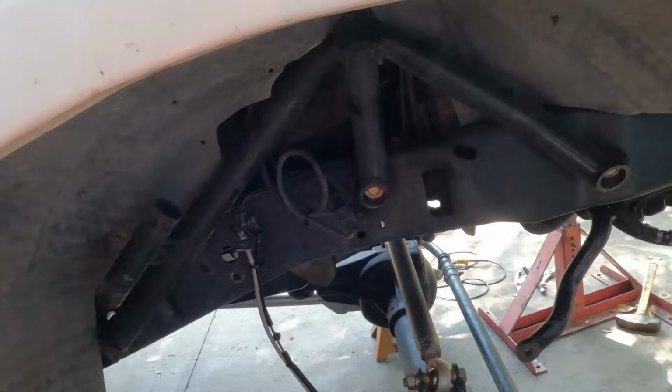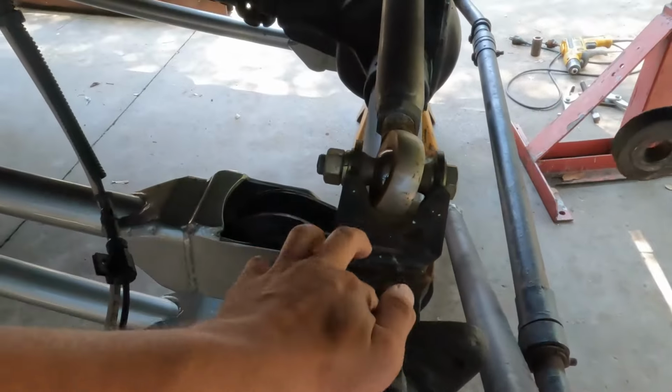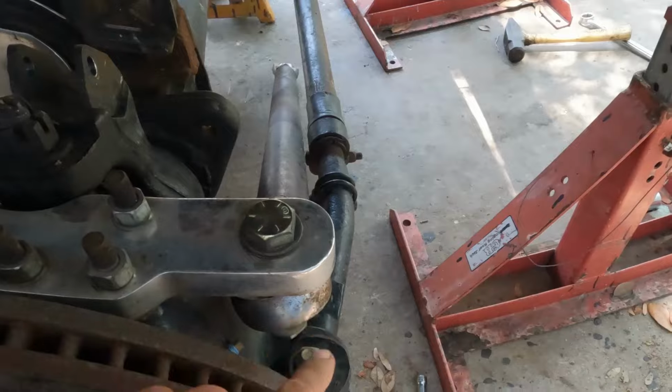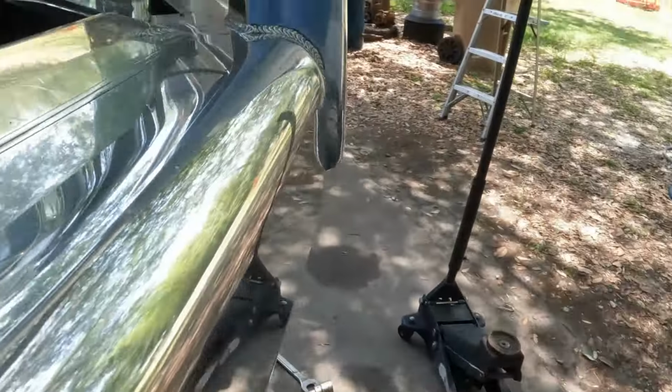Guess we're just gonna pop the shock hoop off real quick. We're gonna go ahead and get the shock hoops powder coated while they're off, because, you know, might as well. Probably gonna pull these off, raise the truck a couple inches. This steering is gonna get flipped to the top of this high steer knuckle. That's pretty much it for the white truck today, I think.